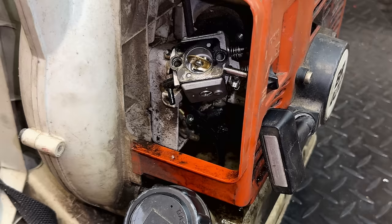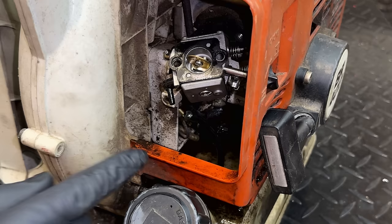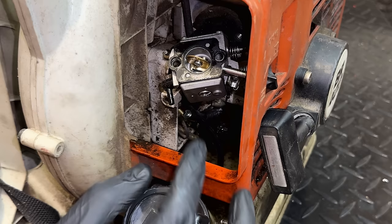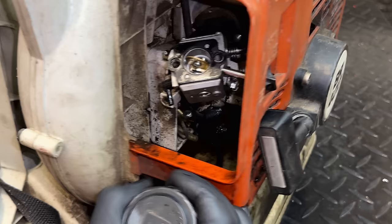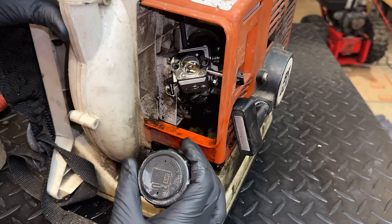So I don't know if you can see this. I just walked over to the bench to get my pressure tester, and you can see the fuel is actually spilling out, and that should not be happening. The tank should be venting right now and not allow the fuel to climb up to the top of this tube like we see. So if I loosen the cap, we should see that disappear. And we do. So I don't even need the tester, right? I mean, we just tested it. If I lock the cap tight and give it a little time, we'll see the fuel appear there again.